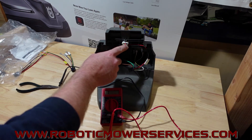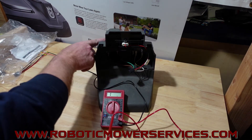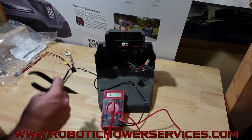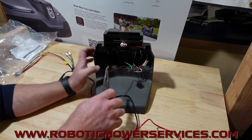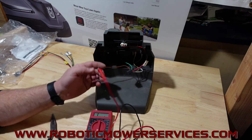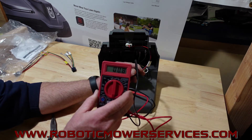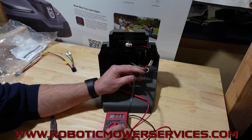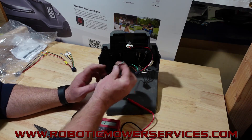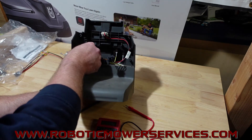We'll also do that with your positive and negative wires where your low voltage cable connects — just check the plug out there coming through to this plug. If when you were doing that from the terminal out back where your boundary wires and guide wires connect, and you have higher resistance than one ohm, then all you've got to do is disconnect the wire in here and go back to checking from the connector on the end of the wire to the one in the plug. If you get 0.9 or 0.8 ohms, you know that's good. But if you had a problem where it was like 1.2 ohms when measured from the connector on the outside all the way through, then you'd want to clean up your connection here where this wire plugs in and clean up the terminal outside, then test it again to see if that drops down.